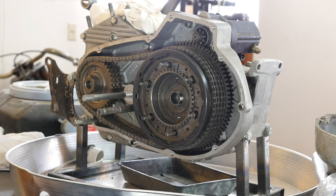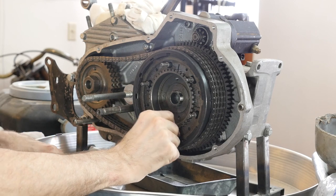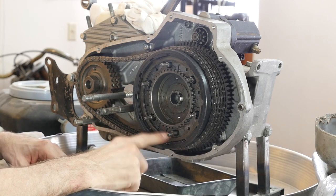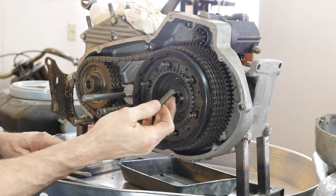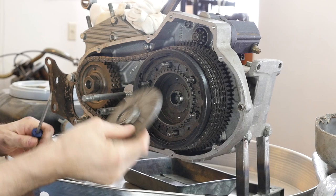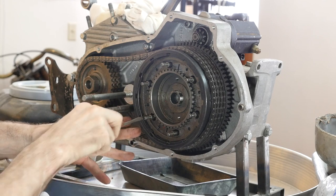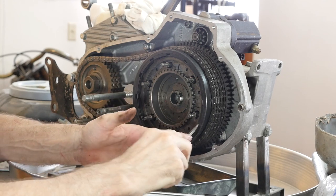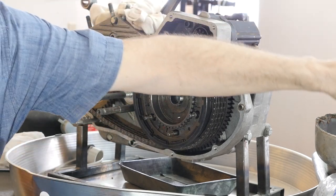Next thing, we'll get a screwdriver — nice little straight slot. There's a wire. These are the spacers. The first couple years they actually adjusted it, then they got smart and said there's so little material in a wet clutch to wear off, you can just use these fixed spacers. And so you're just reefing down on those with this plate against the big spring pressure. Let's put that in the primary cover. With that off, you can get the clutch pack out. This big heavy thing — it is a friction, got friction here. Then the steels.